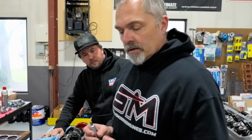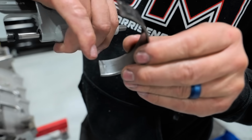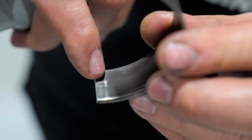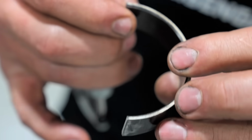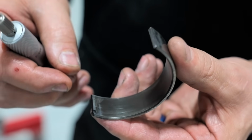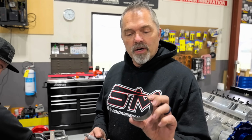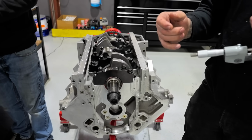That bearing is defective. Not only that, I'm not sure if you can see in the light, this is what the bearing looked like out of the box. You see it actually rubbing and scrubbing right there. It's worn this little coating off when we had it in the block, untorqued and turning it. So it's a 2-part deal. It's still getting pulled round by torque, which is normal. That's fine. But I just wanted to check it because I could hardly believe what was going on there. This bearing, you put the other bearing in there, and it turned over fine. Or the original bearing back in there, turns over fine untorqued.